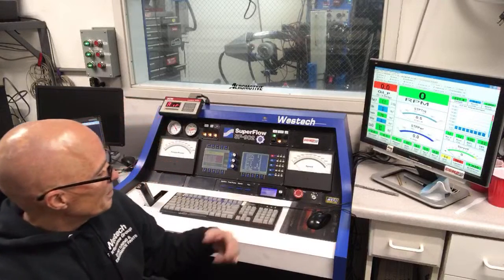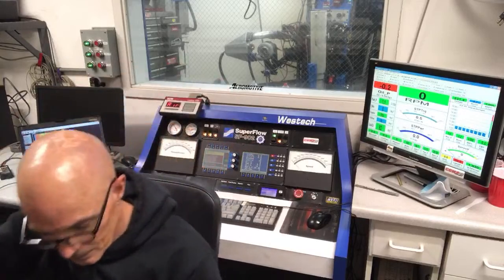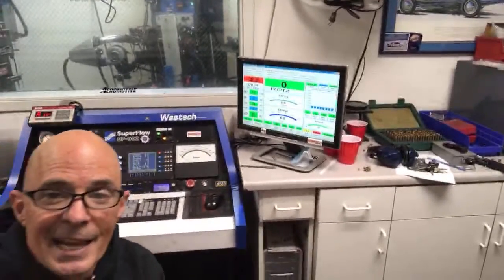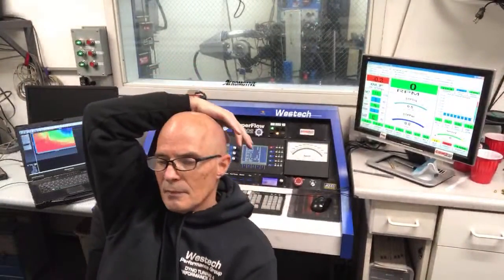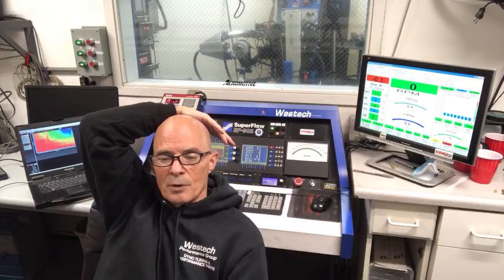It's obviously going to make a lot more power than the blowers did. It makes like 415, 419 on one of the pulls right in there at this boost level. This is not a stock 3800. If the guys that are new here, it's not stock. It has a cam. We tried ported heads on it, but the ported heads didn't really do anything. It has the stock lower L67 blower manifold on it, and then a hogged out blower, stock throttle body. So it's basically just a cammed version of this motor.